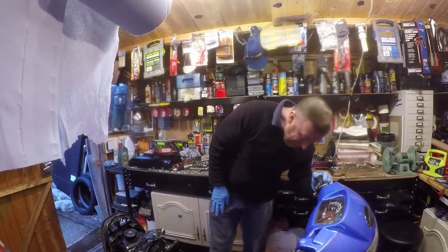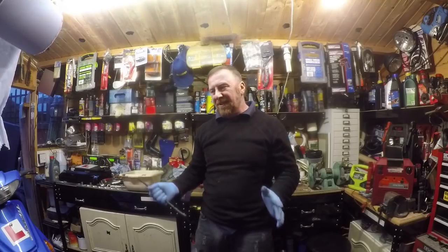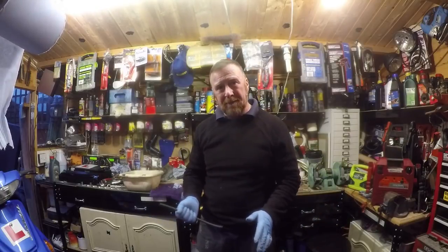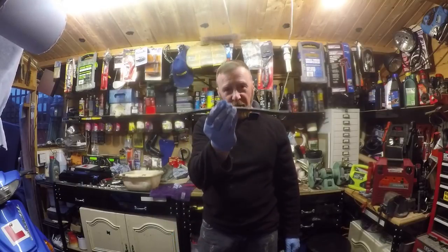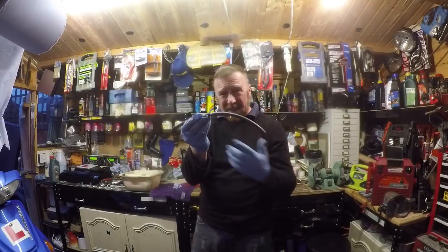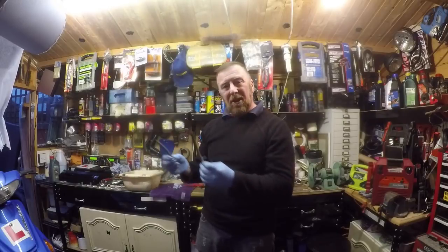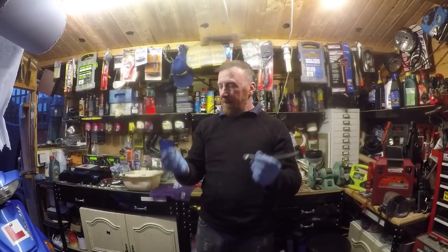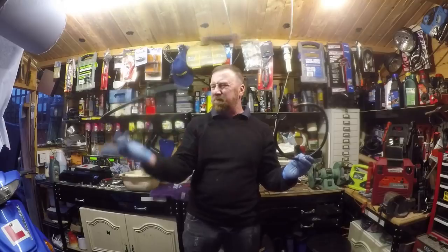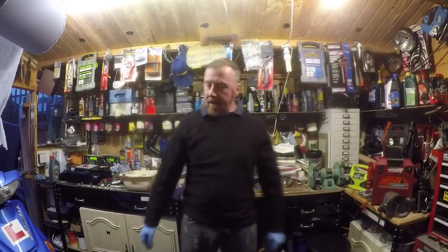He also said he had a 70 kit — the head does look quite new actually. Right — the battery: just tacky, had no acid in it whatsoever. It's dangerous — the wrong battery to put on its side, with bloody gaffer tape holding it in place. Stupid. Then I found something else that's stupid — the bloody fuel line, more gaffer tape around it. This is petrol, next to a battery that was badly wired in — it could spark! And that was leaking. I really thought this was a simple job. Get a new bit of pipe for God's sake — that is so dangerous and stupid.